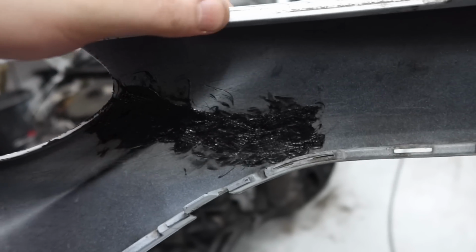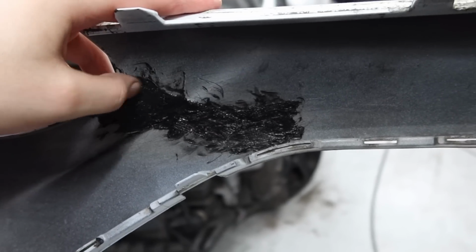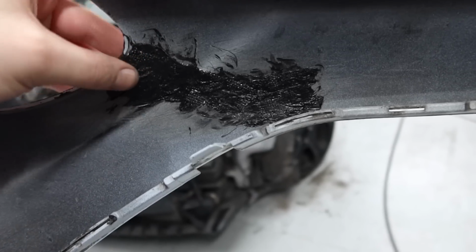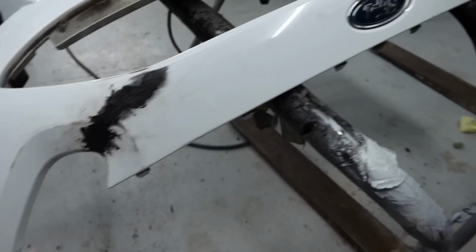And just like that guys, the repair work is done. I've put a layer of mesh back there. I've welded it into the original plastic, and on top of that I've got the fibre flex as well to give it extra strength. And on the face side of it, I've opened up the gap a little and I'll put a layer of fibre flex over that. So that's nice and secure now. That's not going to open anytime soon. So that's done and out of the way.